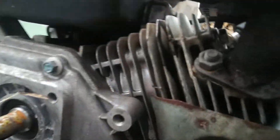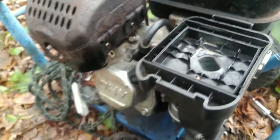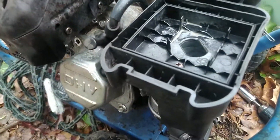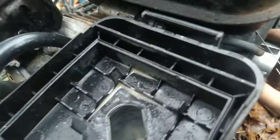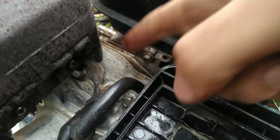That's got a bit of blow-by. I definitely see signs of that leaking on the head right there. It's starting to backfire a bit - I wonder if it's just getting hot and starting to detonate with the extra compression. She's still living though, she's still got compression. It's definitely starting to leak right there, blowing out the side of the head.